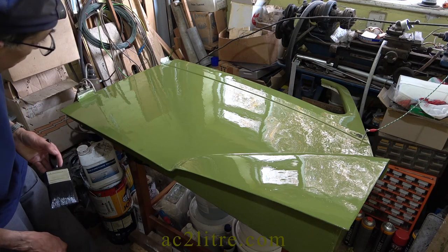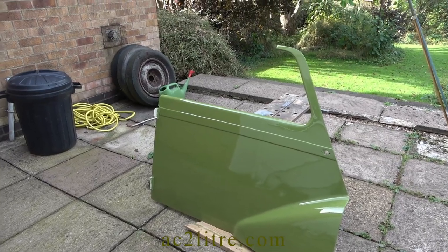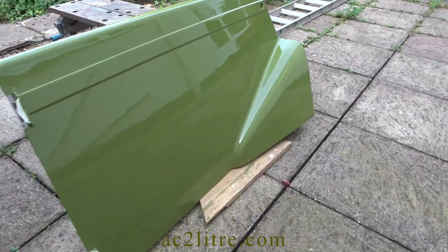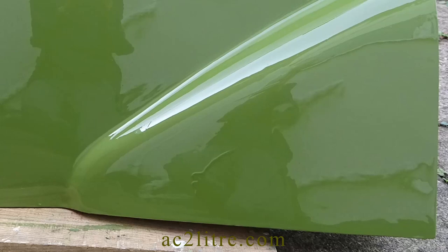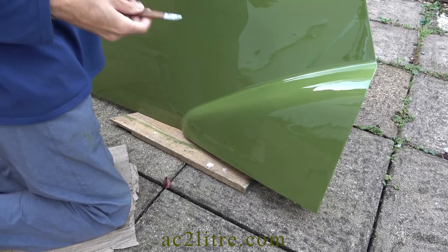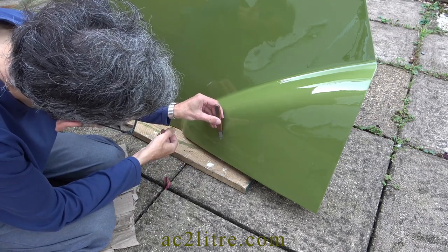I can see a couple of small strips where it has not fully covered — usually when the paint or varnish is not thin enough, and maybe I didn't brush it on hard enough. Returning to see how this clear coat turned out brings both good and bad news. The bad news is that there's a large sag where the door pocket slopes, and the small touched-up area looks a bit messy. The good news is that the coat has levelled well, with those blemishes having almost vanished, and very little dust or bubbles — maybe mixing in the PPA additive adds bubbles. The day after applying, I cut away the thicker bits of sagging with a sharp craft knife, then left it for at least two days before rubbing down.